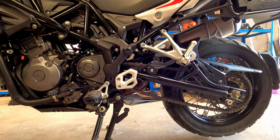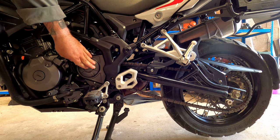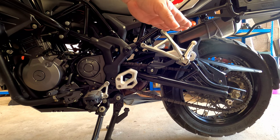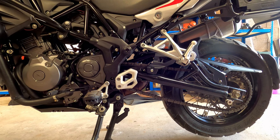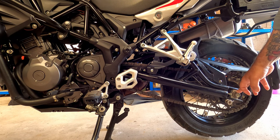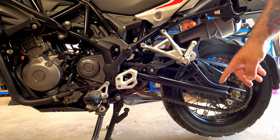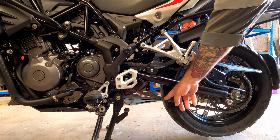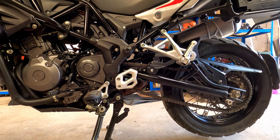What we need to do is undo these bolts here and take this cover off to give us access to the front sprocket. We then need to lock the back wheel off and undo that nut — once we've cracked that nut we're good to go. We then need to release the back wheel, undo the adjusters, slide the spindle out and take the wheel off. Before we do that, we need to break the chain. There are two ways: you can either grind down the rivet and use a chain splitter to push the link out, or get an angle grinder and cut straight through. Today I'm going to be doing the first method because my angle grinder is not working.